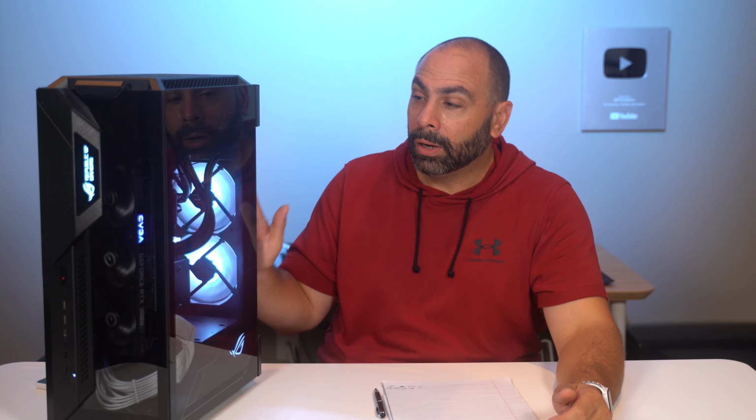The CPU was actually fine, especially while gaming. It was running between 43, maybe 53 Celsius, somewhere in that 10 degree range, depending on the load. And I think that there is enough airflow back here coming from the radiator that allows the CPU to maintain a lower temperature and thus higher boost clocks, which is really good, which is obviously what you want. But to keep that going, the fans on the AIO also are running a little bit faster than they normally would. So there's a situation in here where you have to balance what your acoustic expectations are versus what your thermal expectations are.